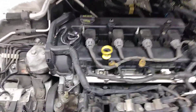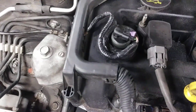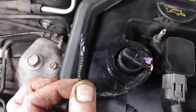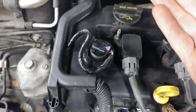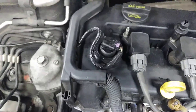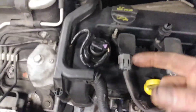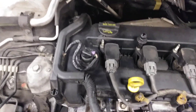One thing I did: there's a new connector spliced in from the Fusion harness so it would fit this car. As mentioned in my other video, I had to grind out the valve cover to get the grommet to fit. I put RTV on the grommet, put it in place, then RTV'd around the edge just in case there were any irregularities from grinding. There's no RTV between the solenoid and the seal — it seals up fine.